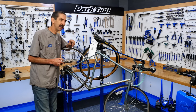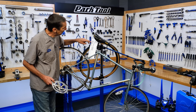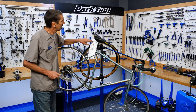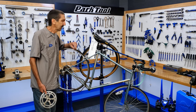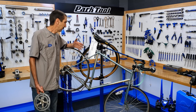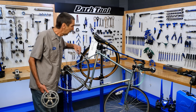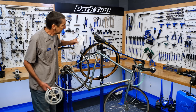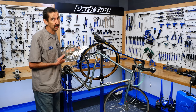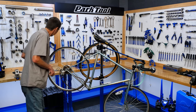But which one? We had a 1, 2, 3, 4, 5, 6 speed back here, 14 tooth, 15, 17, and so on. On the front, we have a 52, 40. We're gonna go ahead and pick the 40, 17. Well, we don't have a 38, 18 for your cycle speedway, so we're not using that. We're gonna go 40 here and a 17. That's gonna be our typical one speed, close as what we've got, okay? So we're trying not to buy parts. More on that later.